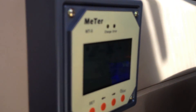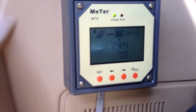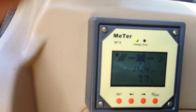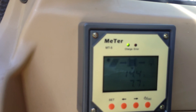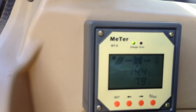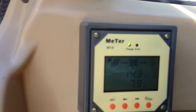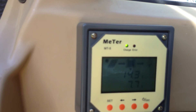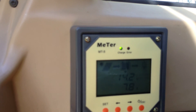That's what it's doing at the moment now. 14.3 volts, 7.8 amps going at the moment — sort of a sprinkle of sunshine. There's no load coming off the fridge right at this very minute, that sort of jumps up and down. It gets up to about 11 amps when the sun's really baking it. And of course when the fridge kicks in, it'll normally sit just above what the fridge is taking out. So I can have 5.5 amps going into the battery and 3 to 5 going out to the fridge, so it continues to charge. It's doing quite well.